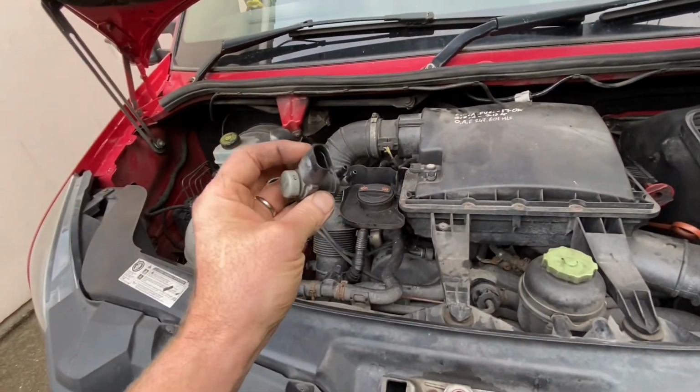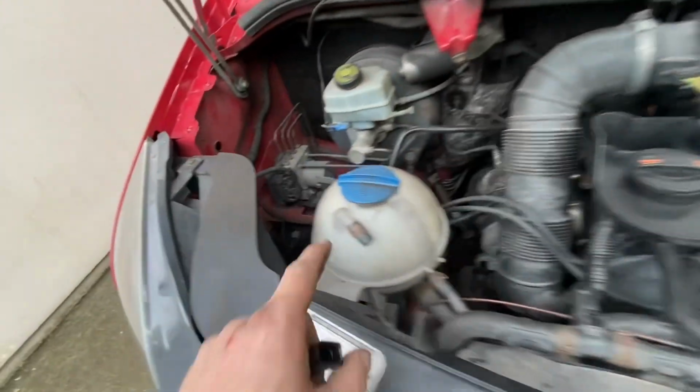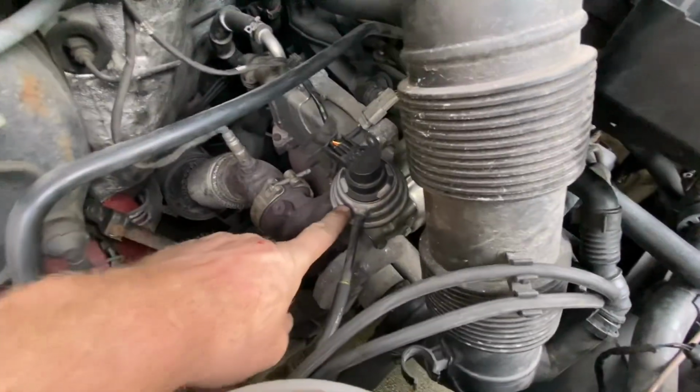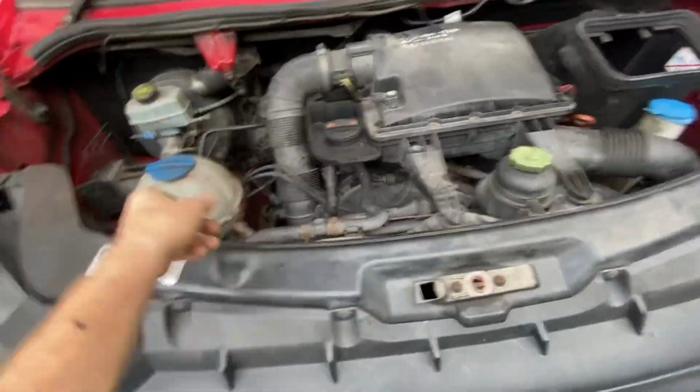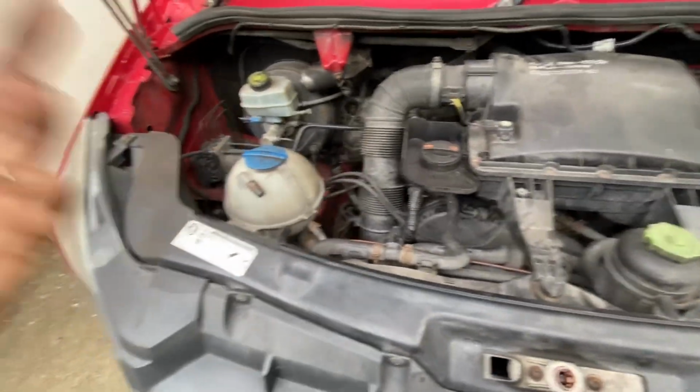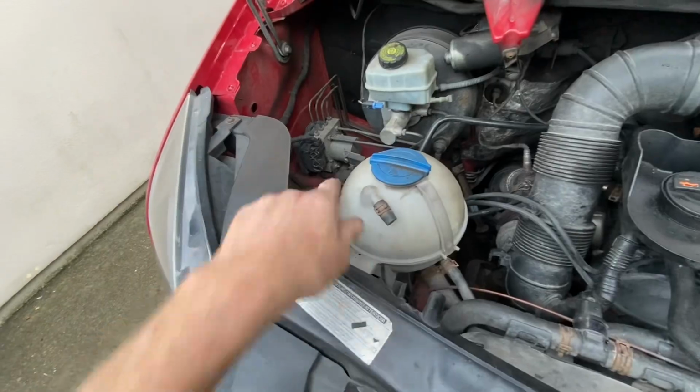Anyway, the pipes swapped around on that solenoid sitting down here was the fixing of it. It's the smallest things that are hardest to find. So if people say there's a small problem with my car, as a technician or a mechanic, you know there and then that's going to be a problem. You have lads changing the likes of these, wiring these things up. You had me even doing continuity checks because of the codes on top of the ECU. Do I have a wire broken somewhere? Blah, blah, blah. But the long and short of it, all it was was a vacuum pipe around here. So, school day, or just a normal day where you're hunting down stuff and you find answers. That's what we do all the time.